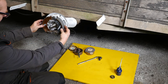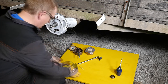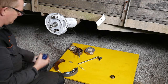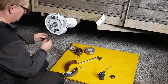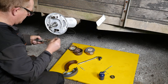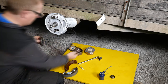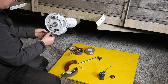I'm just going to have a look at the position of the shoes, make sure everything's correct — and it all seems to be right. A drop of oil on the adjuster to make sure it pivots nicely. A bit of copper slip on the end where the eyelet goes, and then we can hook that back in. I'm also putting copper slip on the ends where they contact the brake shoes themselves.